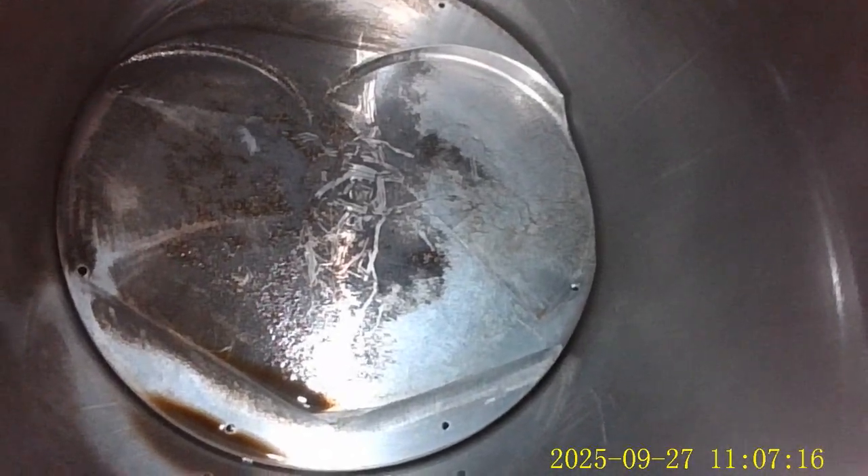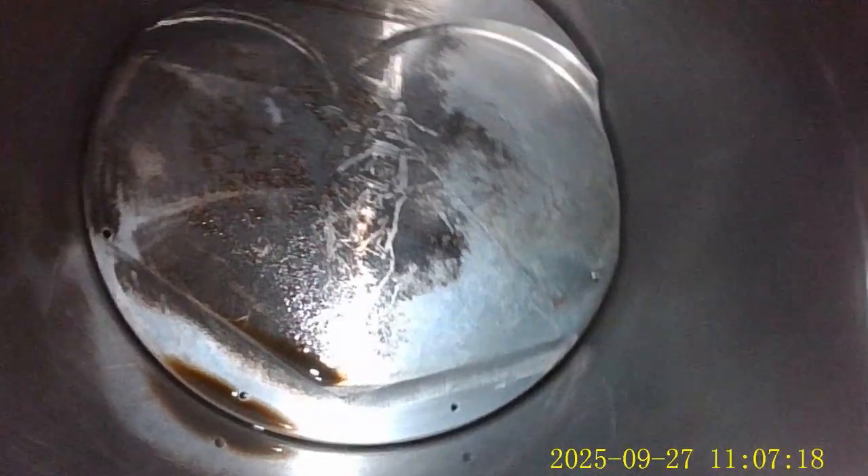Now there's a little bit of oil there, which I'm not really concerned about. It's got gas-ported rings. The thing really hasn't been beat on much — some dyno pulls, that's about it. You can even pull back a little bit. The cylinder walls look pretty darn good. I don't see any issues with that.